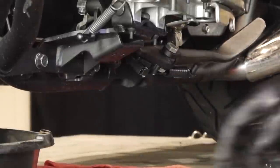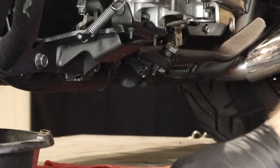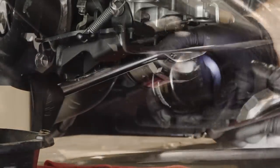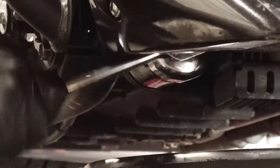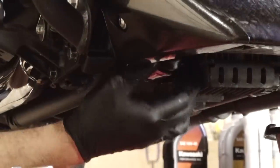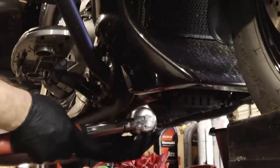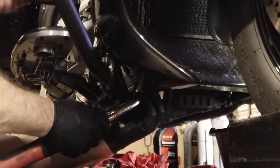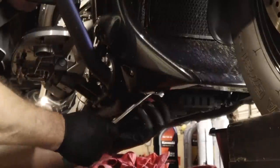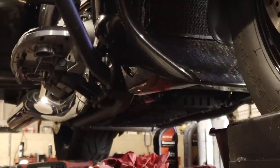Next let's go ahead and get that oil filter off the front. It's kind of hidden up in there, but it is actually facing up high on the other side. What we're going to use is an oil filter wrench just like that. Make sure you've got your drain pan under there because a fair amount is going to come out once that seal separates from the engine case. Next we're going to take just a little dab of oil to coat that seal before we put it on. The oil filter has a torque setting as well and that's 13 foot-pounds.